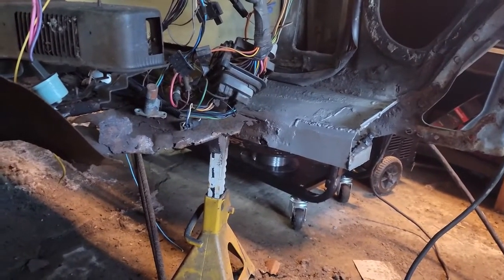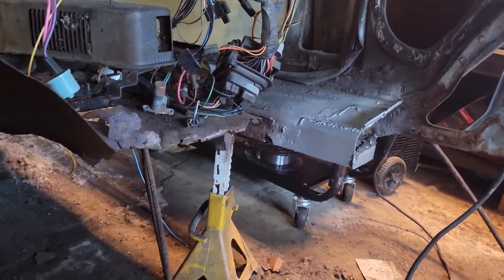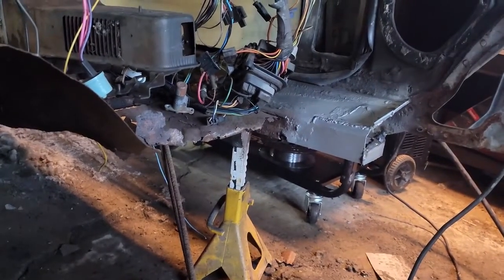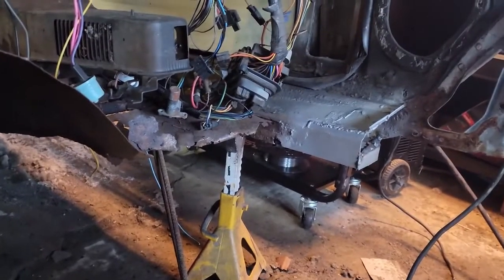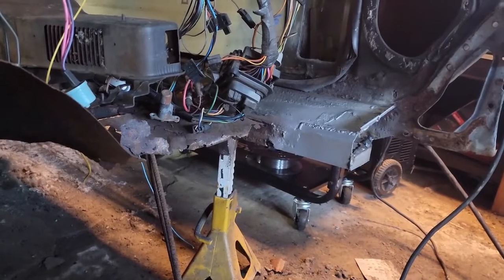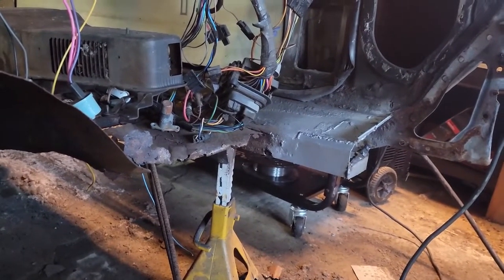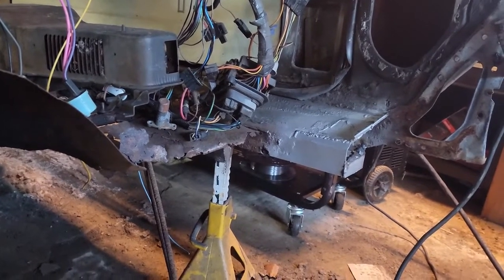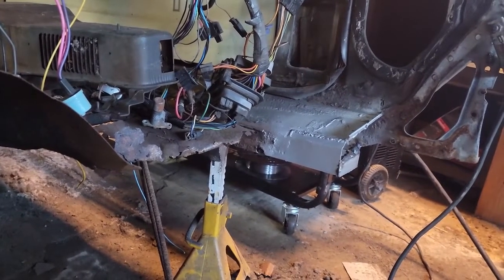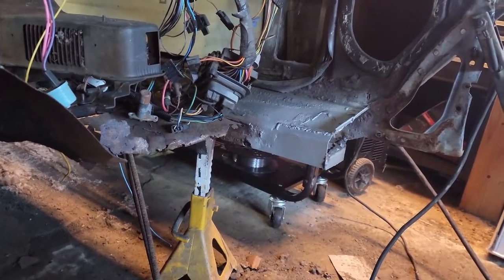Then I don't have to work till tomorrow night, so maybe I will bring the subframe in here early tomorrow morning, and fix the body mounts on it and along the sides of the frame rails at the bottom. At least on the passenger side, it needs to have about a 2 foot section replaced, probably 2-3 inches tall. But that's all right. So I got the metal.